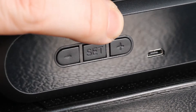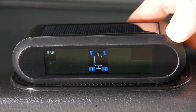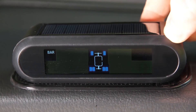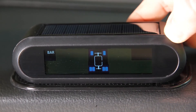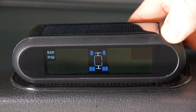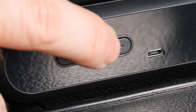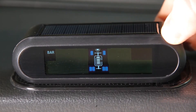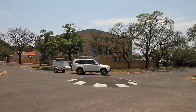To change a setting, tap the set button once — the option will start to flash, and changes can then be made using the plus and minus buttons. When the necessary changes have been made, press the set button once to accept and save. When done changing settings, hold down the set button until the home screen appears. Note that tire pressures will not display immediately — you need to drive the vehicle to activate the sensors.